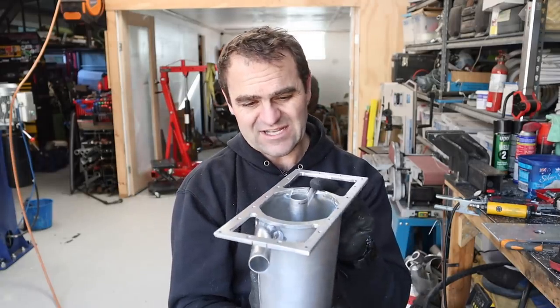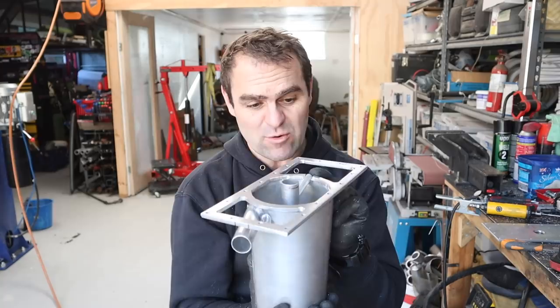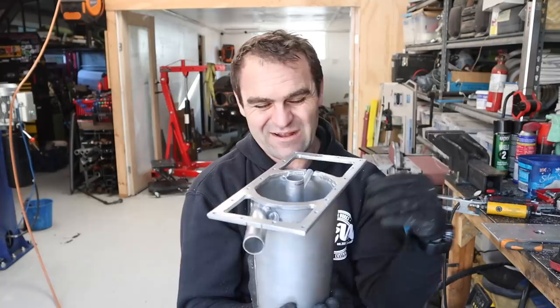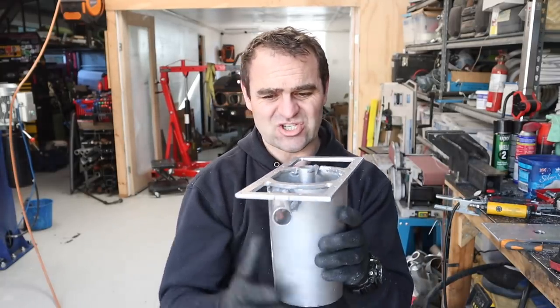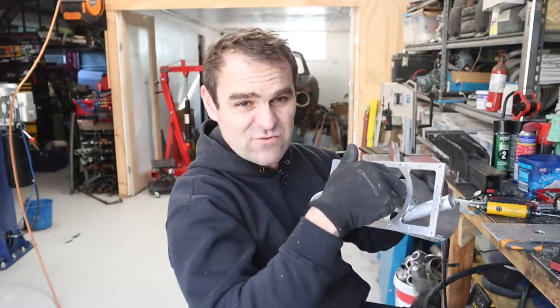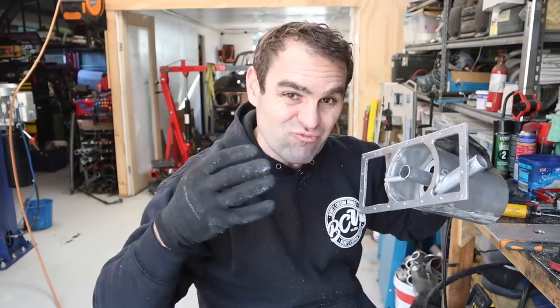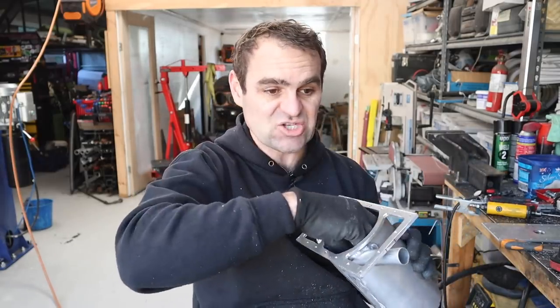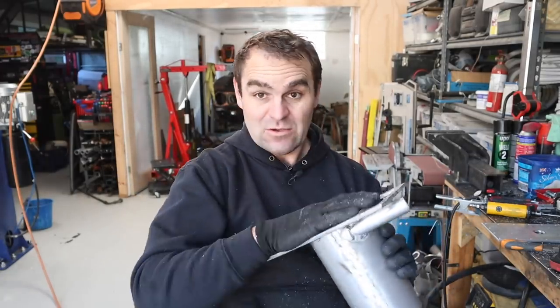It's not completely sealed over here — there will be a little bit of airflow so vapors can travel between them. It's all about trying to de-aerate the oil. Same with these baffles — these baffles aren't perfectly sealed, but it doesn't really matter. It's more about slowing the oil down and just getting it to settle down a bit before it actually gets back into the engine. That is how that works, so now I'm going to start tacking some of these bits together — we are coming along nicely.